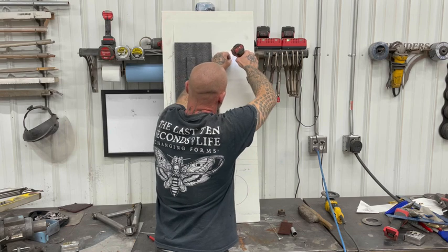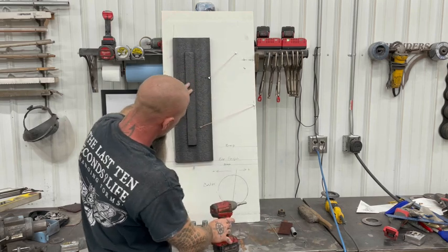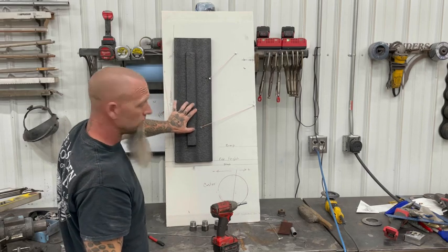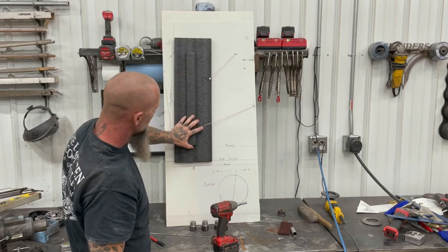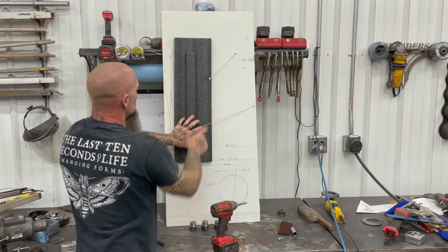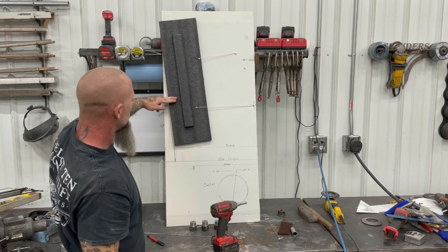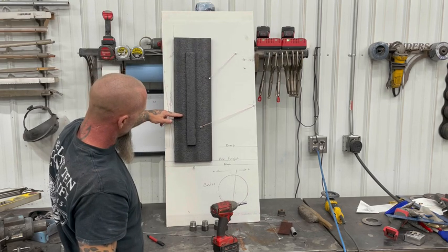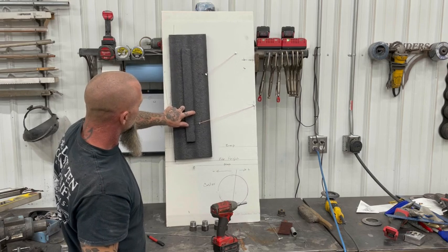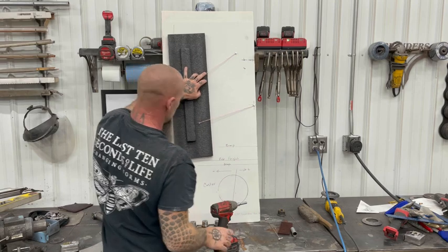Let's say we move this mounting location up to here. So at ride height, I don't know if you can see on the line, but we have our camber at ride height with that upper arm location. Because remember, our lower arm isn't going to change. This isn't going to change because this is where our ball joint sits on our spindle. But now watch what happens when we cycle. See how much we went positive? I mean, we're still good there, but look how far negative we go at full droop. And this is all just changing that mount from that location to that location.